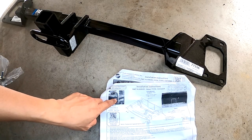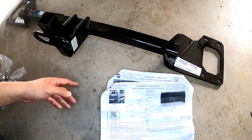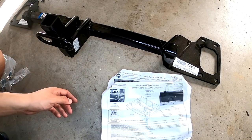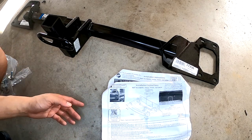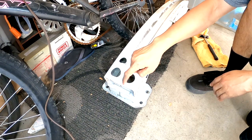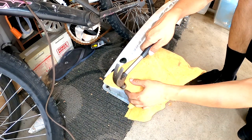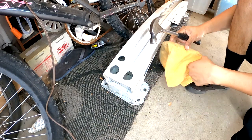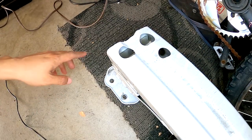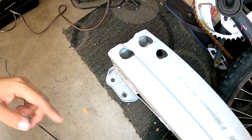If you look at this area closely, you'll see two lines — top and bottom — that indicate what area to cut away from the bumper beam. I didn't feel comfortable cutting away any material, so I'm going to use a very small hammer and lightly tap that area in. The hitch plates are maybe about a quarter of an inch thick so I'm going to hammer it in a little bit and hopefully negate the need to cut away any material. This is the portion they tell you to cut out — I'm just going to hammer it in very gently and round it off just enough. I'll cover it with a cloth to protect the paint. The result is very subtle — almost not noticeable — but this section is pushed in ever so slightly to make sure it does not come in contact with the bumper. I did that on both sides.